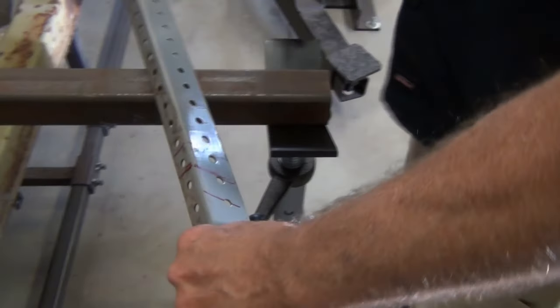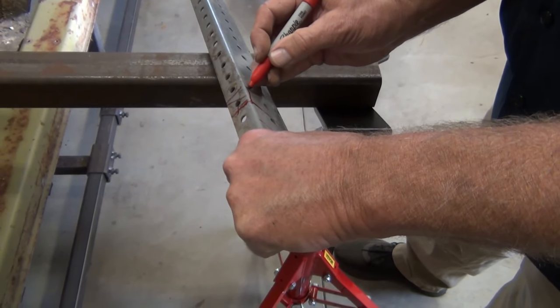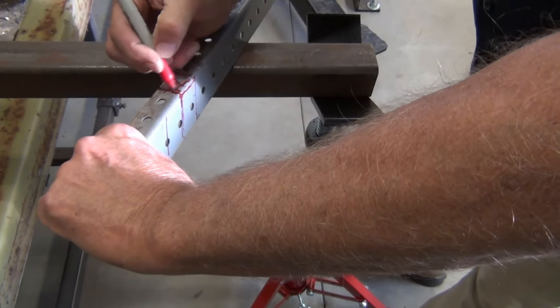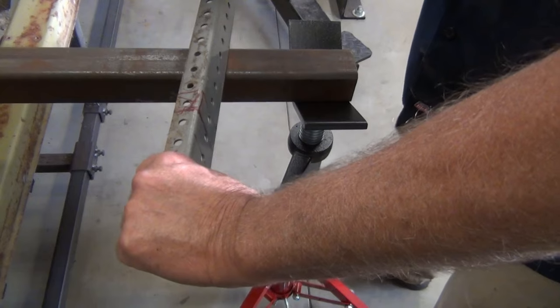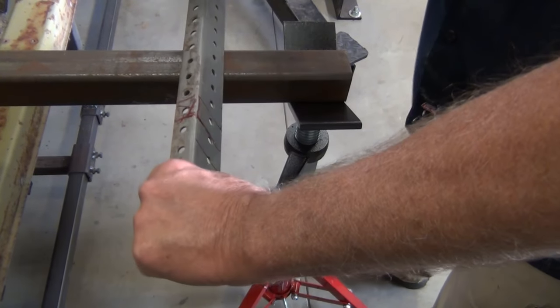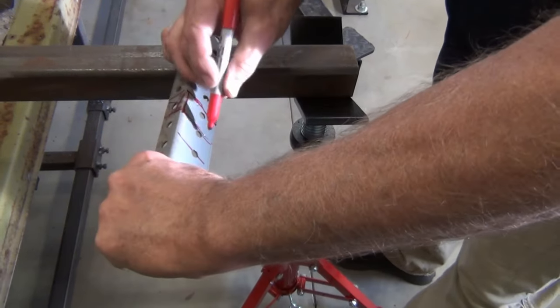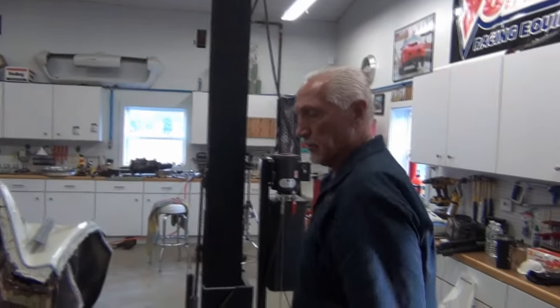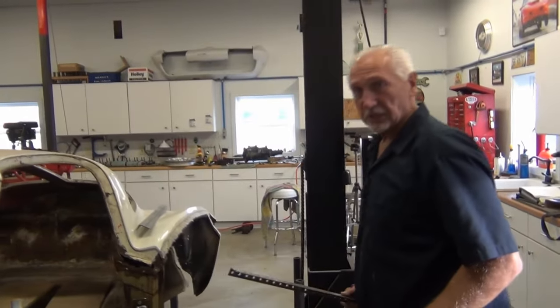I'm not an engineer, so you've got to think through this guys. What's going to be left on this — this is out. So cutting there — I need to cut that out because this is going to be bent back like this if you can imagine the way the angle works. I could cut this out, notch it, and make it more rigid, but I really don't think I need that rigidity. So this is the bend point — this is going to be bent so when I cut it here, cut here, and cut here, bend it like this and that'll go right in there. I can tack weld it from here where I can get to it with a little die grinder, so that I can grind the weld out and not mess up my solid birdcage.